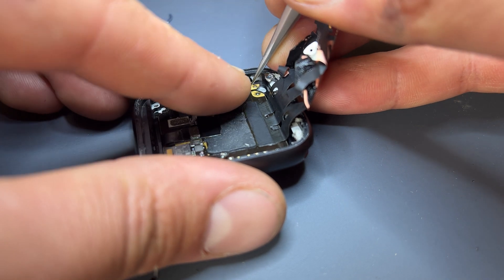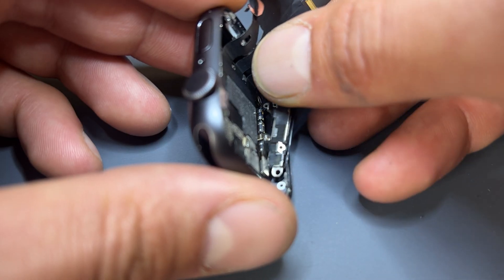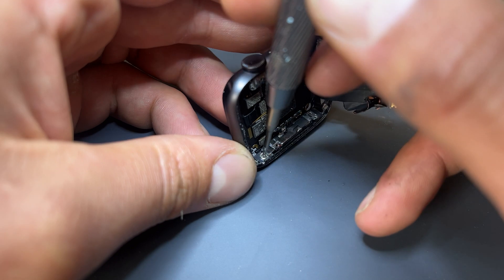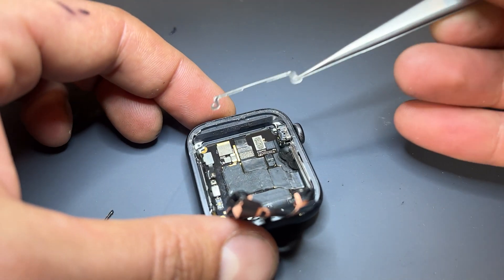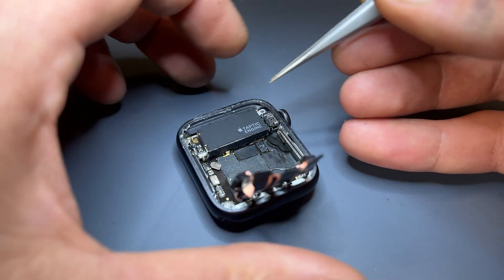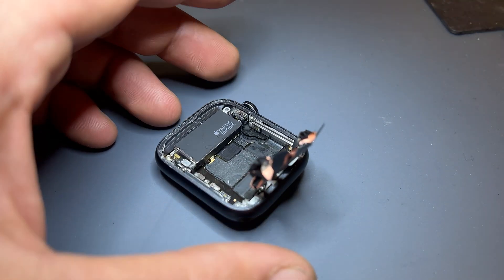With the board reconnected, go ahead and start reconnecting all the connectors to the side of the device — tweezers will be a good friend here. Make sure all the screws you took out are going back in, because whilst the water resistance seal has been broken, you want to do your best to keep water out. Reinstall the microphone on the left-hand edge and reconnect that little FPC, followed by the three screws. Next up, install the little brackets that hold down the logic board. For the taptic engine, its connector sits around the underside, wrapped around the antenna cable, so reconnect the two connectors first before screwing it down.